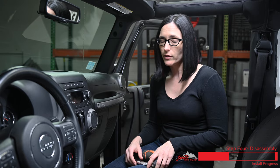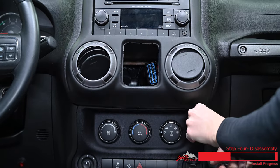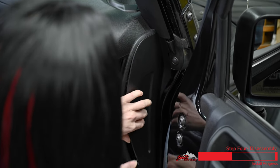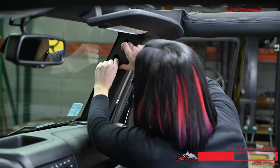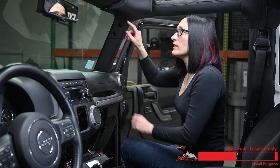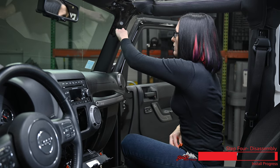Now that we've mounted our camera and run our wire to the front of the vehicle, we're going to disassemble the front so that we can get the mirror mounted and those cables run. First we're going to take out this center piece to access a seven millimeter screw and then release the bottom of this panel — that's where we're going to get our power from. Next we're going to remove the glove box by squeezing it in to release the little clips, then remove the side of the dash to access wire routing. We'll remove the fastener in the bottom hole of the A pillar — you don't need to remove the 10 millimeter in the top hole — and then remove two torx screws holding in our sun visor, pull down the entire plastic piece, release the clip, and pull out our A pillar.